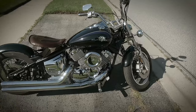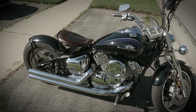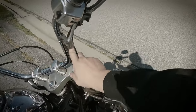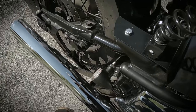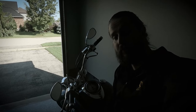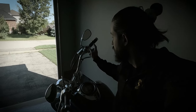Let's let it warm up and take it for a quick ride just to make sure the kill switch button doesn't accidentally unlock while riding and kill the engine. The brake is still wired externally but will be internally wired into the bar next time so the cable won't be visible. After the test ride, the buttons work beautifully — they don't disengage, they start the bike and turn off the ignition perfectly, and they're nicely hidden away. No more need for the big cluster. Subscribe, hit the bell, check out the Instagram and website. Next episode: internal throttle.